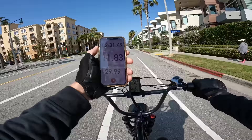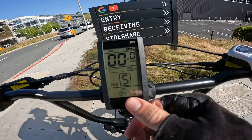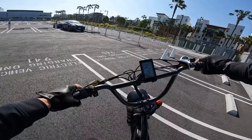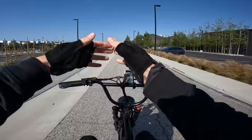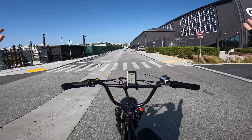I'm calling it quits at 30 miles - this thing still has a lot of punch, still hitting 29 mph with six percent remaining. Honestly they're selling themselves short because it's showing 44.5 volts and according to the chart that's actually more like 35 percent remaining. You can run a 48 volt battery down to 39 volts. I rode this thing like a motorcycle, barely pedaled at all today - maybe half a mile total - and I weigh 200 pounds. Considering the performance, price, and specs on this bike, I think it is worth the price if you're looking for a moped style bike like this. Thanks for watching guys, give me a thumbs up, drop a comment, catch you next time.